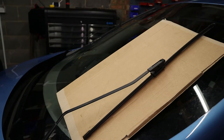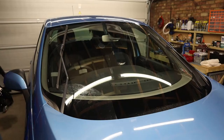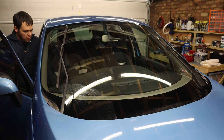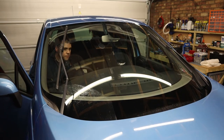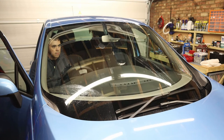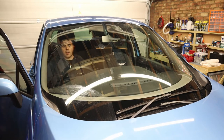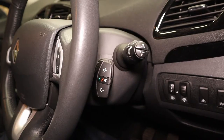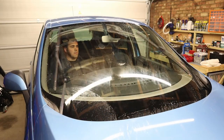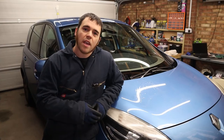It's not going anywhere. Cardboard out and we'll give them a test. With our new ones on and secure, take it out of service position — ignition back on. Put the wiper stalk back to the park position and give them a quick test. Run the washers and close the door so you don't get sprayed in the face. Just make sure they don't contact each other or any of the paint and you're good.